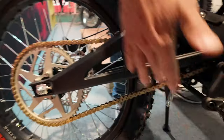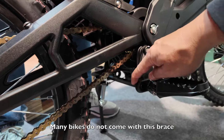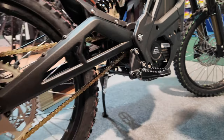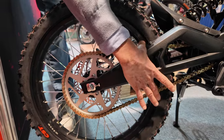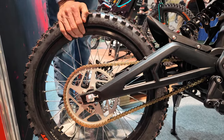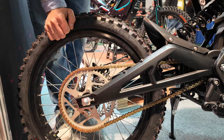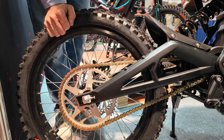We also just added the foot peg spacer back here — this is new. For those of you watching, this can be a weak spot on a bike that doesn't have it. We also just changed the sprockets to smaller sprocket configurations to decrease this area here, reduce chain slap, and make the bike quieter. I hate noise when I'm riding these things. Chains can make a lot of noise if they're hitting areas they shouldn't be.